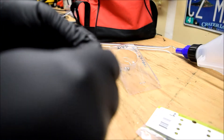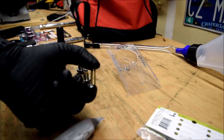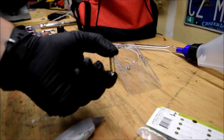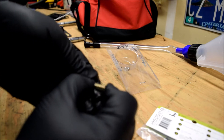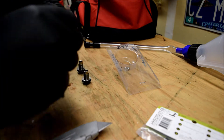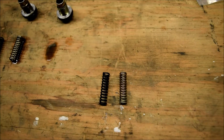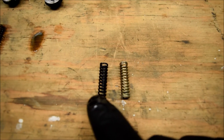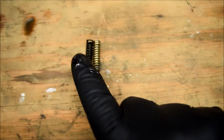Let's get these OEM springs out and compare the two. Here are the stock springs — I'm pushing them down as hard as I can. There's some resistance but I can push them down all the way. And here is the Hybrid Racing spring — oh yeah, that's a lot stiffer. You can tell that the Hybrid Racing spring is thicker, about the same size but a lot stiffer. That's what's going to give you the notchy feel going into gear.